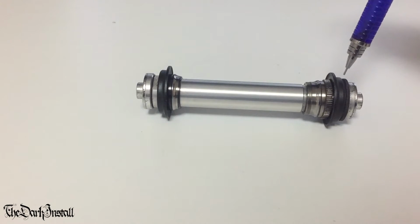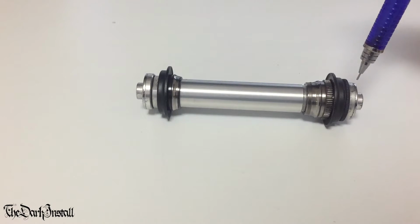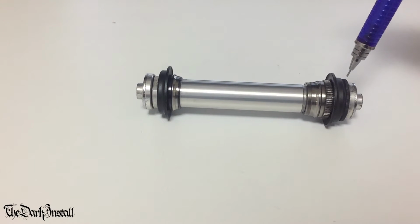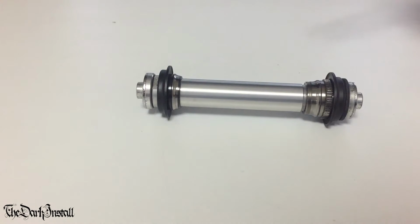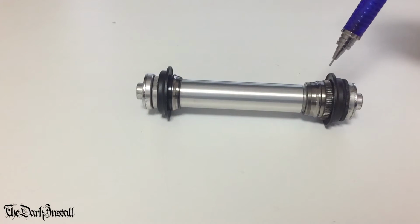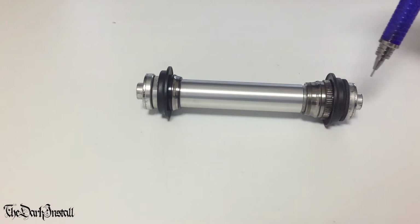This plastic part has a matching spline inside it, which is actually twice the pitch of this spline here, so you can micro adjust it pretty well. This slides on to this part here and locks the system in place when you lock this outer lock nut down on the outside. Now this plastic system sits slightly away from the face of this preload system. So when you tighten this down, that prevents this coming under any extra force from this side, meaning you can get really accurate and really smooth and consistent bearing preload without it being affected by how much you tighten this part down or by how much you clamp your QR lever in, which is, I think, an excellent system and pretty much genius.